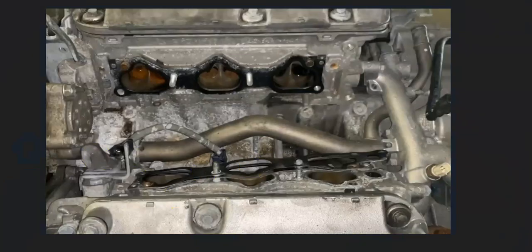If the knock sensor tests good and there are no problems with the wiring, something going on with the engine could be throwing everything off and the onboard computer just thinks the knock sensors failed. Usually when this happens you get other codes. For example, if the timing belt slipped a notch and is throwing the timing off, you'd typically also get cam sensor codes. So pay close attention to any other codes you're getting.